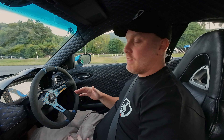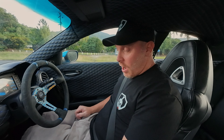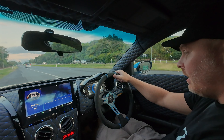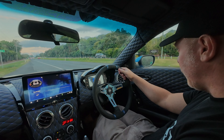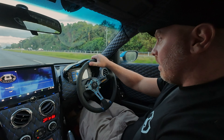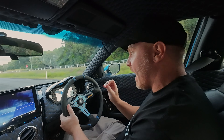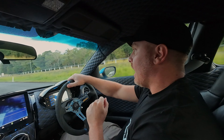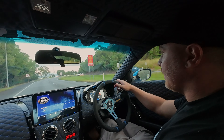For everyday driving I wouldn't recommend installing a clutch like this — it's more of a racing style clutch where you're not stopping and starting all the time. So from where I'm touching the pedal, I'm just starting to grab — you can see we're just rolling. From that point to fully engaged is about two to three millimetres of pedal travel. That was a fairly smooth take-off there, but I had a lot of time to do the motion. I'll pull over and try a quicker take-off to show the difference.